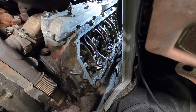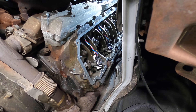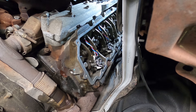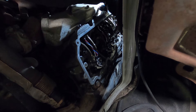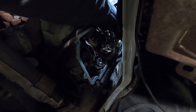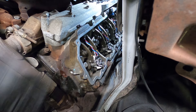Okay, the next two — I'm going to try to get number three in from back here. You should be able to see me put number three in; it's kind of far back from your perspective. Feel it down in the bolt hole and use the T40 again, start it by hand. This really is the worst case scenario injector job — shuttle bus, huge alternator, double AC.